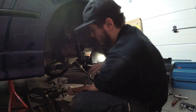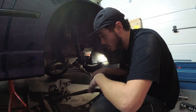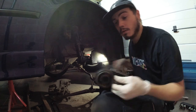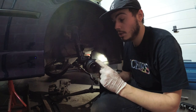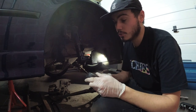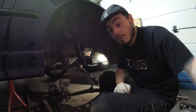The assembly of the knuckle and the lower control arm is finally out. I'll clean this mess up and continue to work on the lollipop bushing right here. I'm going to be drilling holes in there, maybe using a file or a saw to try to get the iron ring out on the side, then wedge a flathead screwdriver in and punch it up — it worked fine for the other side.